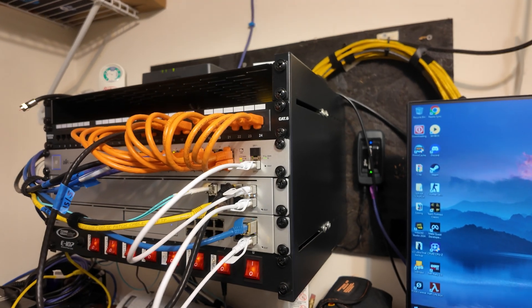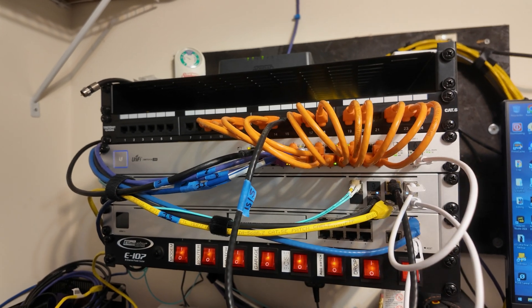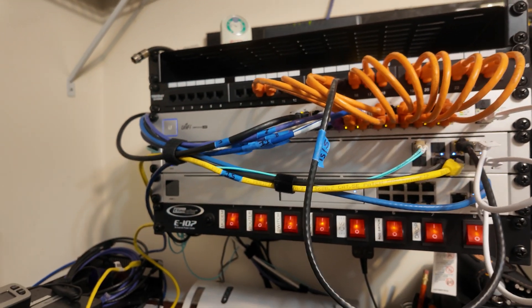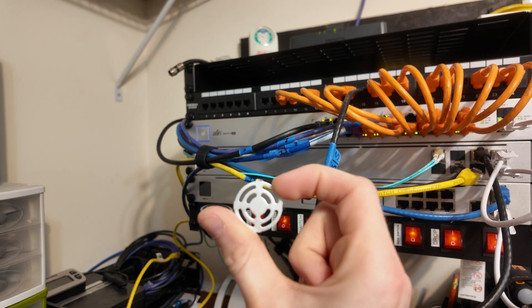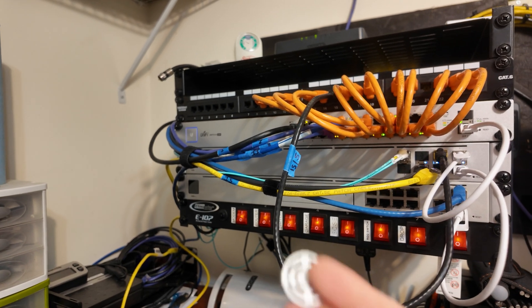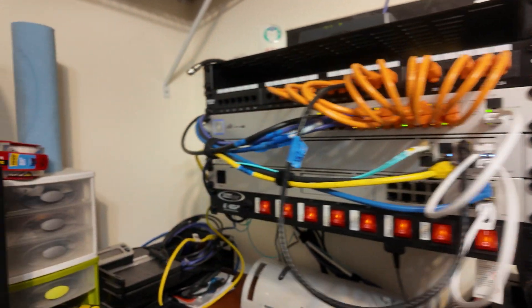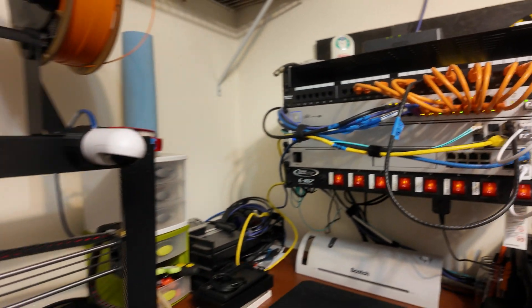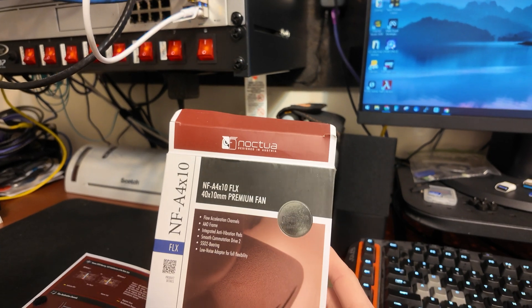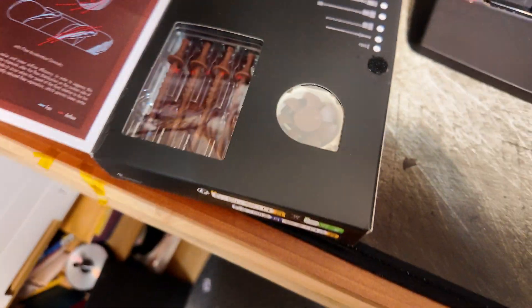What I've done so far to try and quiet this down — I've had this thing four or five years now and haven't done anything with it. But now that I'm down here on this computer more, it's gotten pretty annoying. So what I've done so far is cut out the fan grates covering the 40mm fans. There are two of them in this switch. That changed the tone to be a little lower pitched, a little less annoying, but didn't really change the volume much. So what I'm going to do is try and replace the two fans with these Noctua 40mm fans that are supposedly much more quiet.